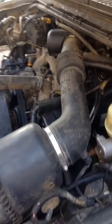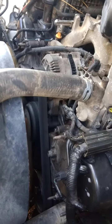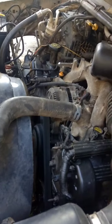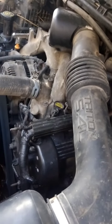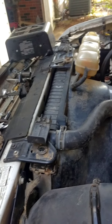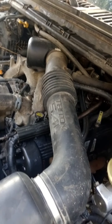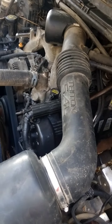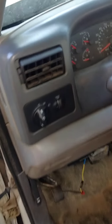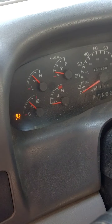After priming it and charging the battery, put some water in it - it's alive, it's running now and it's very quiet. No chain noise. I'll let it warm up a bit and check the valve covers to make sure they're not leaking. Got to top off the power steering fluid and I noticed a radiator leak from one of the transmission cooler lines - the radiator may have to be replaced. But it fired right up after priming and sounds great. Full oil pressure looks good too. This thing had zero oil pressure at idle before - you had to rev it up to get any oil pressure. Now it's looking great.